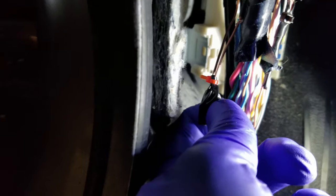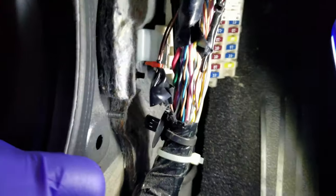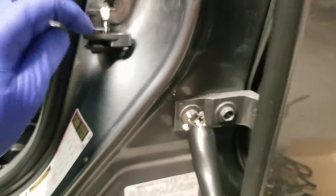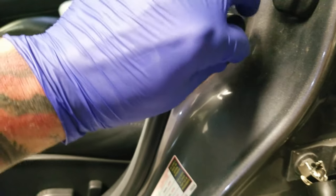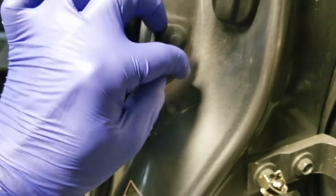This is for the dome light — you can see I put electrical tape on it and zip tied it. It's really important not to leave wires exposed; I've seen so many cars catch fire because of a bad connection. Go ahead and tape them up. Put this panel back on — do not forget to do this, because if you close your door and forgot to screw this back on you will break it, and this is OEM only. So consider yourself warned.